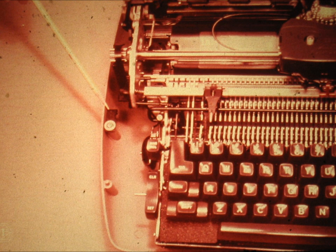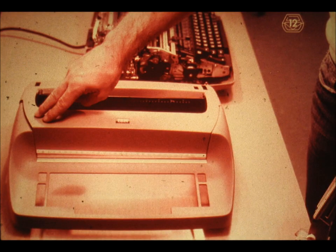When you pull the center section latches towards the front of the machine, this is one of the points on the bottom cover from which they disengaged. Also, take a quick look at the latch on the center section so as to understand how the covers are locked together. You may even consider practicing the reinstallation of the covers a few times before we continue. Be sure not to damage the margin set levers nor the carrier position indicator. After you are done, lock down the top cover or lid and be sure to store the cover away from your immediate working area in order to prevent it from inadvertently being scratched or otherwise damaged.